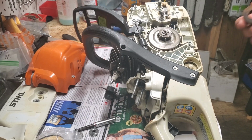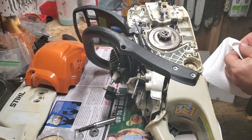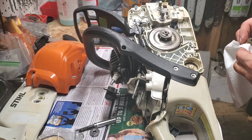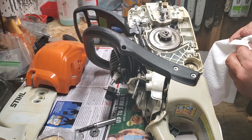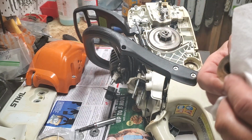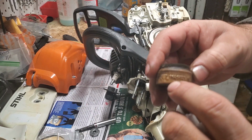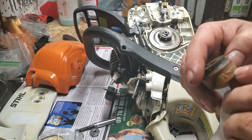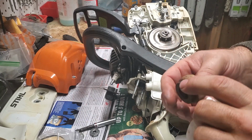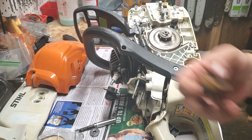Okay, unfortunately I have a used one. I just used my last two. I believe these are similar to several models. The 441 uses this as well. It looks the same, and I think it's the same part number. A foam piece, you guys, and STIHL has their part number stamped into it. I think the whole part number is on these. Nope, most of it. You can see 1141/1103B. And so again, if you Google STIHL MS271 IPL, you can look up the AV system and find this part number if you need this foam pad.